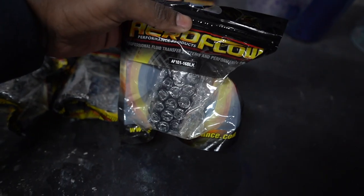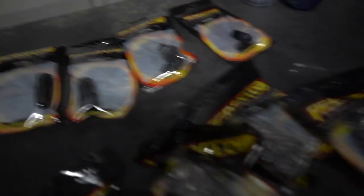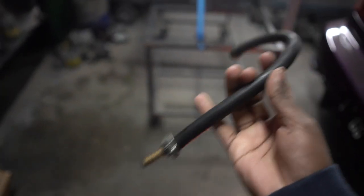The Dash 16 is all for the radiator — I'm running all braided hoses for the radiator setup. Most cars run normal silicone hoses, but I'm going to be running braided hose so it looks a little bit nicer. Instead of having clamps, it's all fittings and screws, so you know it's never going to leak or pop off. For my brake booster hoses and vacuum hoses, I'm using all fittings and braided hoses instead of a normal rubber hose with a clamp.